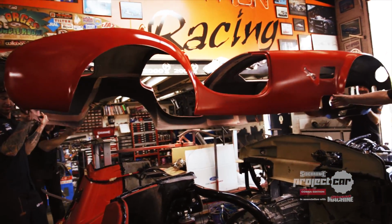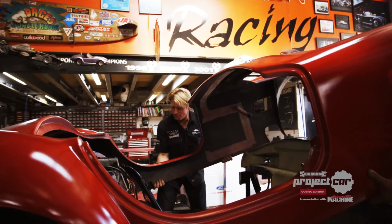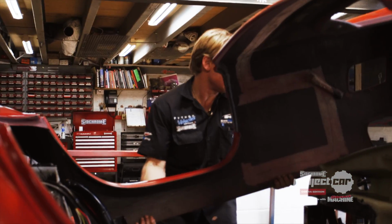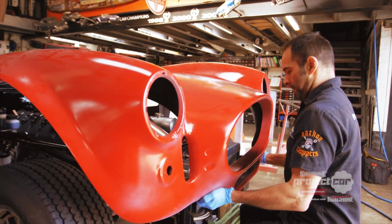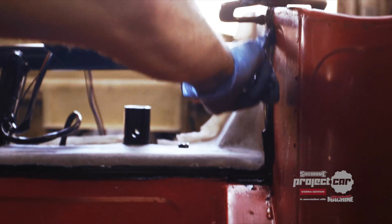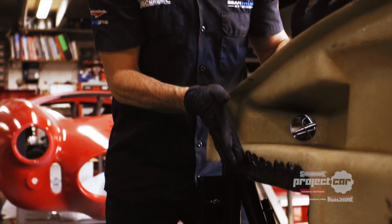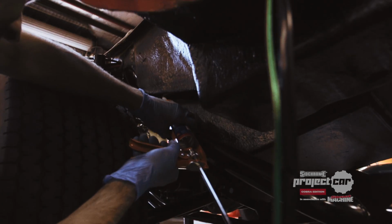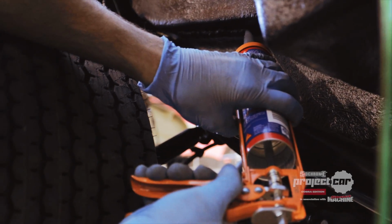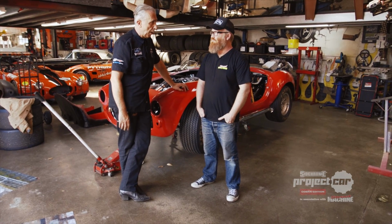We're Sikaflexing those sort of items. We're making sure all the clearances are right, and we're right under the pump because we've got to get it straight to TAFE for the kids to start painting the body. In case people miss this, the body is glued onto the chassis, yeah? Yeah. There'll be some fiberglass areas, so we'll bond some things to the firewall by fiberglassing them, but the majority of the body mounting is all bonded by Sikaflex, and then you'll find it very tough to remove once you've bonded a part to it.